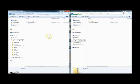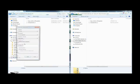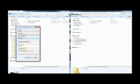Now the way I did mine is copy it to a clean USB drive. What I mean by clean is that before I copy the files, I right click and open this one and format it to FAT format. In my case only FAT32 is available and it goes by default. You can choose the default allocation size, or in my case 4096, and it works for me. So click start. Before you do that, remember that you erase everything from your USB stick, so make sure you back up anything or move it somewhere else so you don't lose your files.